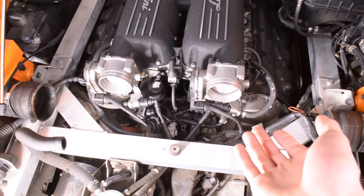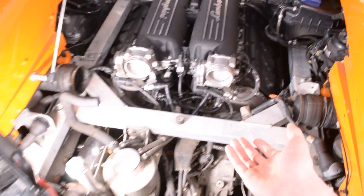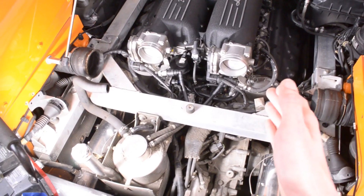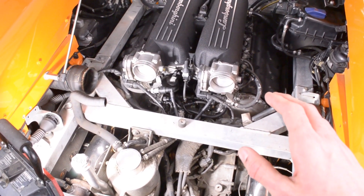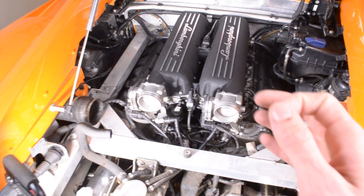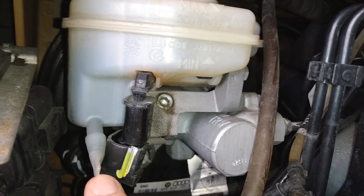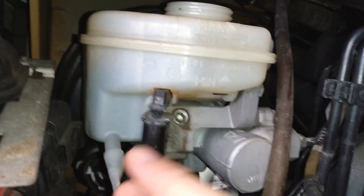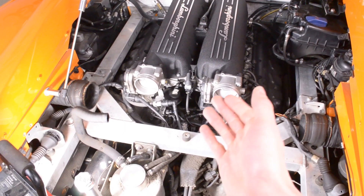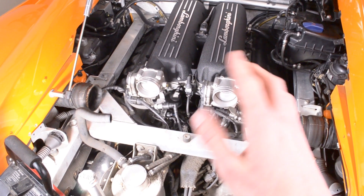You might say: I have a manual car and you just said that the e-gear system actuates the clutch — what does it do on my car? In reality, this is actually very interesting because in a manual car, you actually use the brake fluid reservoir. So the reservoir that is used for the brakes is also used for the clutch. An e-gear car uses the same brake fluid reservoir as a manual car, but you'll notice if you look close enough, you'll see that one of the little ports is pinched off. So if you have a manual car, that's your feed line going to your clutch pedal. If you want to bleed your clutch on your manual Gallardo, be sure to fill up that reservoir first before you drain it.